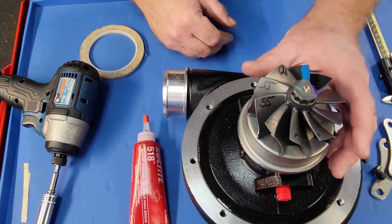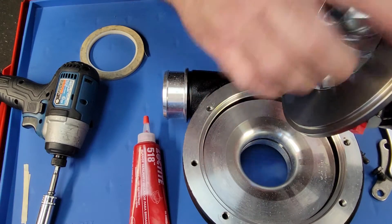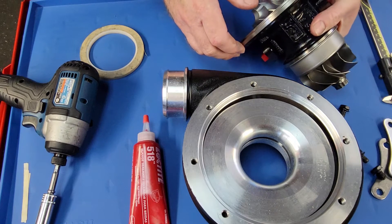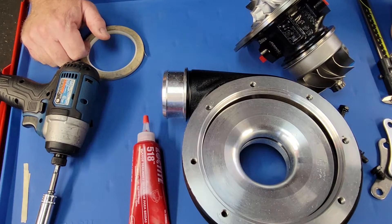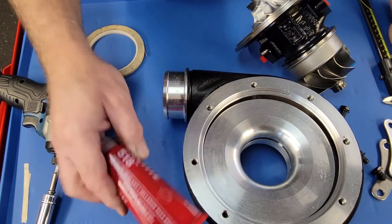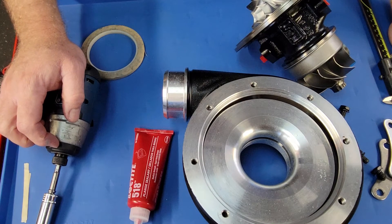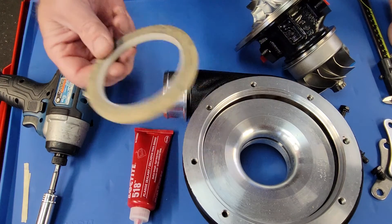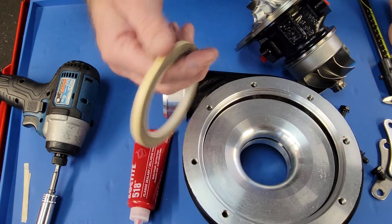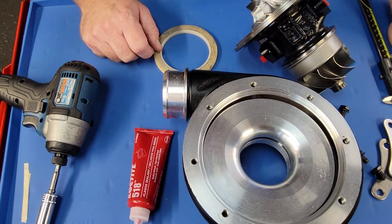If your turbo has been on your car for a while, it's probably sealed itself up. The way these things work is the cast iron and aluminum mating surfaces — the normal moisture content will eventually create an oxide layer between them and it will seal. But a lot of you race guys don't have hundreds and hundreds of miles on these things daily like an over-the-road truck gets, so a sealant is definitely preferred, especially if you've had the car apart and need to go race this weekend — you don't want any boost leaks. This stuff is your ticket, guys. I hope you took something away from this video. Leave me some comments, let me know what you want to hear about next. This is just a simple way of telling on your S300, even S200, some Garrett turbos — as long as it's a journal bearing, the three-piece-of-tape rule applies to all of those guys. Thank you for watching, and we'll see you hopefully next Thursday. Y'all have a good day.